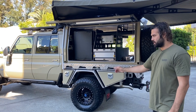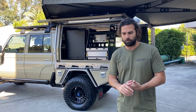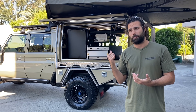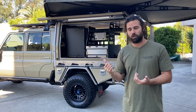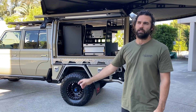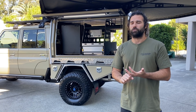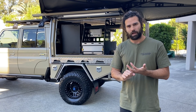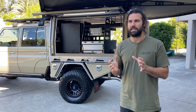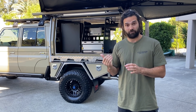Anyway, we've got the manual adjust in here. Part of the JMAX kit you get adjustable panhard, adjustable lower control arms, front radius arms, the big hydraulic brake booster, braided brake lines, the Brown Davis 180 litre long range tank, 4495 GVM, and it also has a 4 tonne towing upgrade. The combined mass is 7995, meaning that if you need to tow 4 tonne, you've got to keep your car at 4 tonne as well.